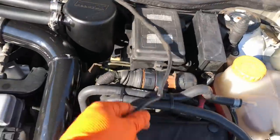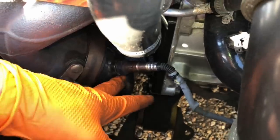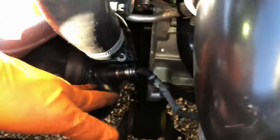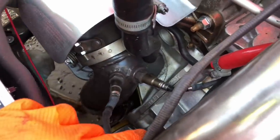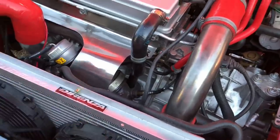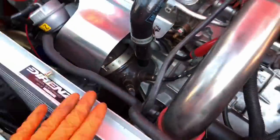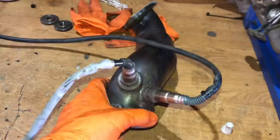Although the wiring is in, I just remembered I haven't got a spare bung for the pre-cat itself. You can see there's a lambda in there but no secondary one, so I'm going to rob the pre-cat off of the red GSI because that's got one in it. On the GSI we have the pre-cat pipe with two bungs - one for the AFR gauge and one for the lambda. This is also a three-inch pre-cat pipe - it's a three-inch coming off the turbo that tapers down to two and a half inch, which gives a little bit of extra flow. We're probably going to swap this pre-cat pipe onto this car.